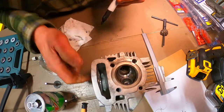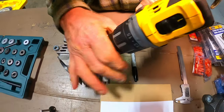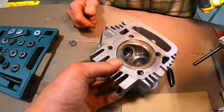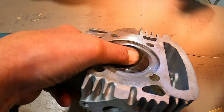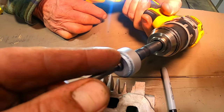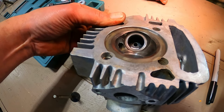We can put some Sharpie on here to see where we cut with the 45 to start off with. Then if you take one of these electric valve grinders and barely touch it a few times — it's looking better already! You can see the cutter is cutting in the middle of the stone — it's dark right in the middle, not running off the edge. Cool, so we'll use this dual valve grinding tool. Give it a little bit more and then finish lapping it to get it real fine.